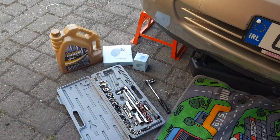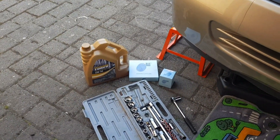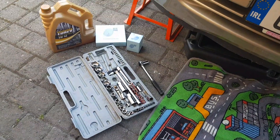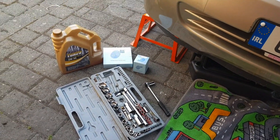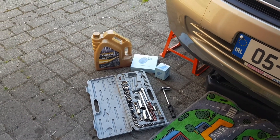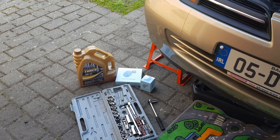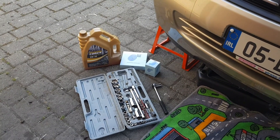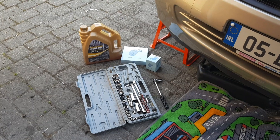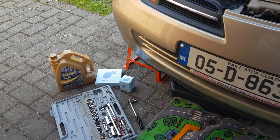What you're going to need is the oil filter, the oil, the air filter, and a 14 millimeter socket for the drain plug. I'm using 5W-30 fully synthetic. You can refer to your owner's manual to get the proper one for your area — this is the one I had around and from the owner's manual I can see it suits, so that's what I'm going to be using.